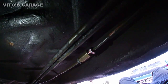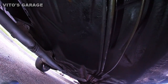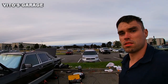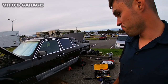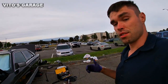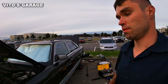Here we have the brake line with one junction union and it goes all the way through. Brake lines are replaced; we're about to bleed the system. I already opened the bleeder screw on the caliper so it's doing a gravity bleed. I added new fluid and we'll check for leaks. Sorry I haven't filmed much — I was really busy trying to finish this — but it's pretty straightforward. Make sure you check your brake lines; if they're rusty, replace them. It's really important.